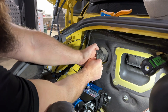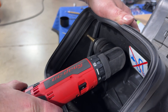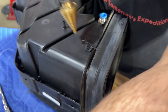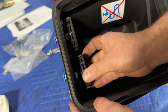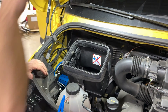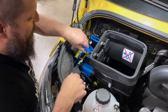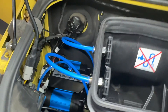After a few more bits of wiring, it's time to get this thing buttoned up and move on to running the breathers. We are mounting these little breathers or air filters inside this intake because it is more likely to get fresh, clean air, which is good for the air compressor. We definitely don't want to be feeding dirty, nasty air into that thing from inside the engine compartment. We took the furry cover off of the air intake box because it is often used as a nest for rodents - being that I live out in the country and travel all over, we took that off to mitigate that issue. Those filters need lines going to them to feed the compressor itself. You can see the lines coming out of the filters down into the compressor, and that center line going to the side is to the pressure control module.